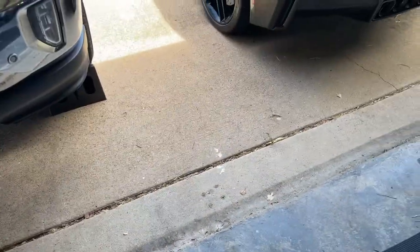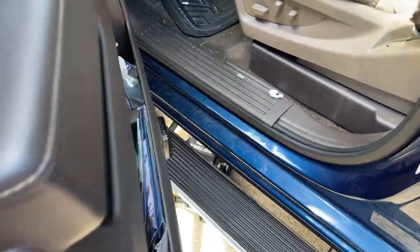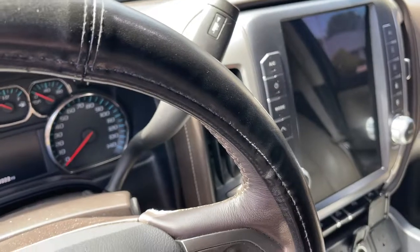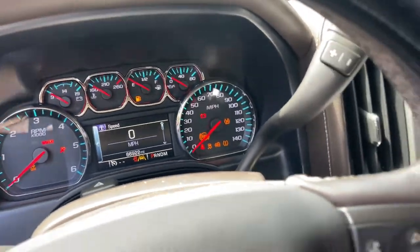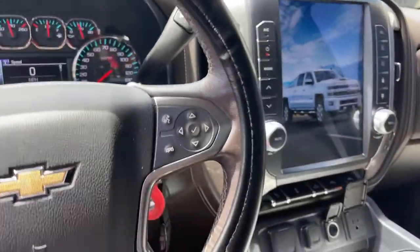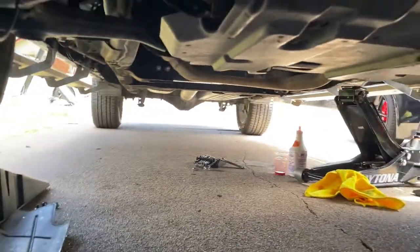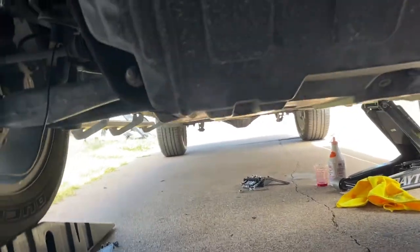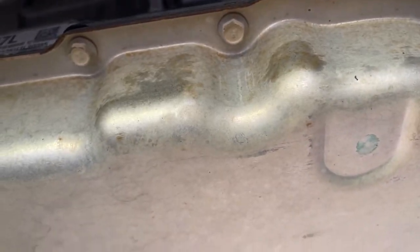After you're done pouring, do not put the plug back in just yet. First, turn on your car and let it idle for about five minutes — that's what I did. I put my jack down a little with the handle because it wouldn't let me open the door. I got about 66,922 miles on it. Let it idle for five minutes, then come back, put the plug back in, and you're good to go. That's the end of the video.